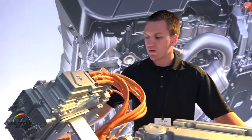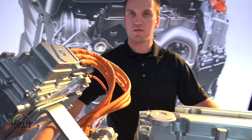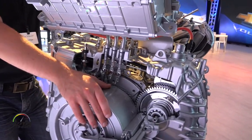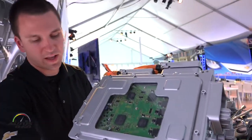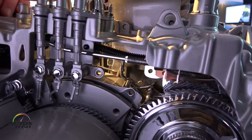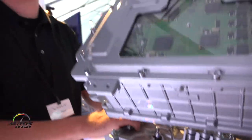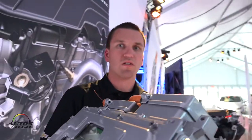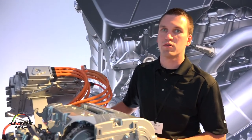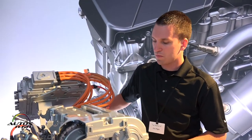In Gen 1 we also had this very large Motor B which did all the driving for electric range, and one other motor that also came along for the ride most of the time when driving electrically. That's where we achieved a very large weight savings by downsizing to two smaller motors that can propel the vehicle in electric driving modes.